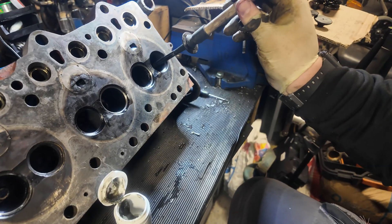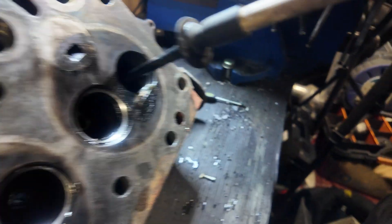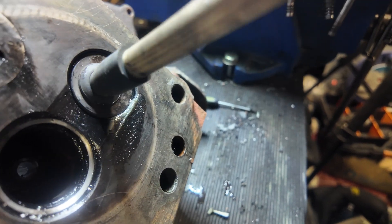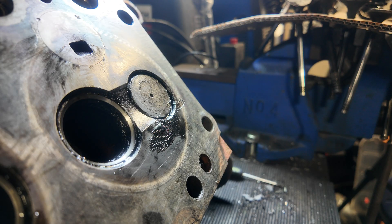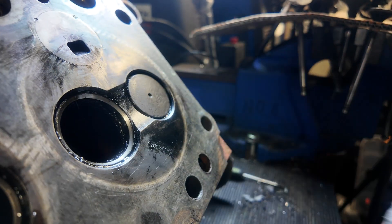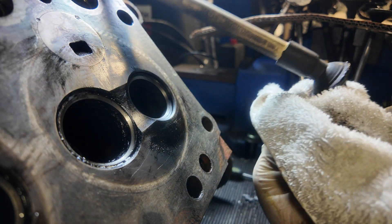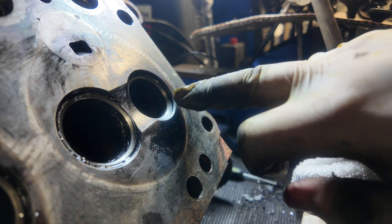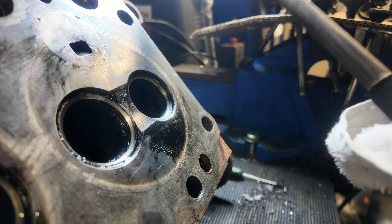Pull your valve out, get a bit of the coarse paste on it — not too much — then push your valve back in carefully and grind. The noise changes over time. It gets to a point where the valve gets really slippy; give it a wipe and wipe the valve down as well. What we want to see is a shiny surface on the seat and also on the valve — then we know it's nice and clean and properly seated.